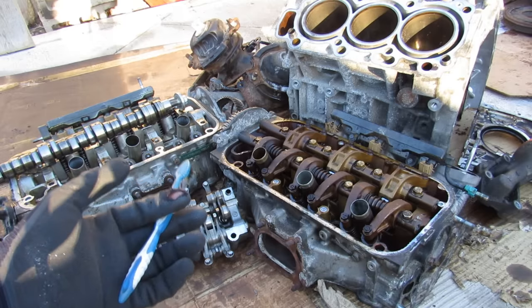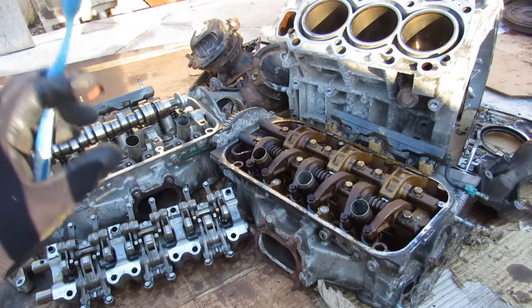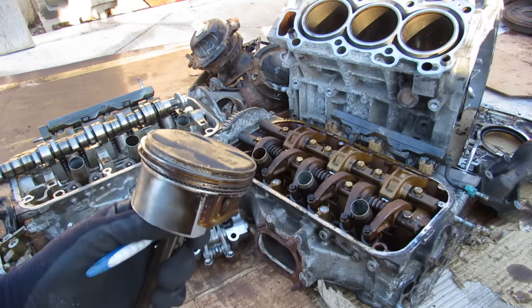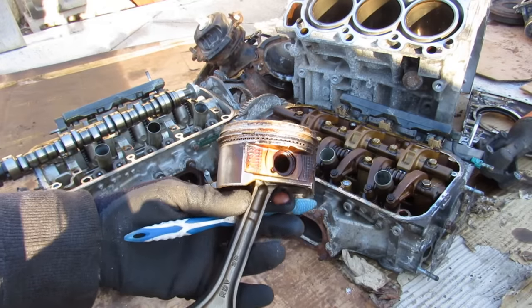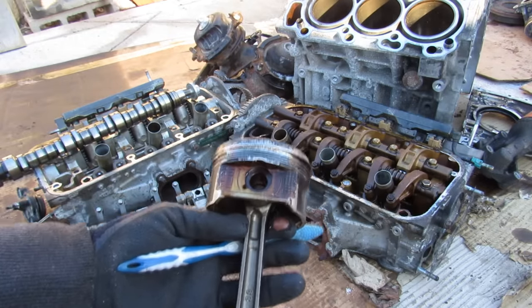If you're considering buying a Honda or Acura with one of these VCM V6 engines, make sure you keep up on your oil changes, check the oil level to make sure it's not consuming too much oil, and check that the spark plugs aren't fouling up and causing misfires — because a ring job is really expensive when you're out of warranty. And that's a wrap on how the VCM system in Hondas works. Make sure you follow on Instagram for more behind-the-scenes footage and subscribe for more videos like this one.